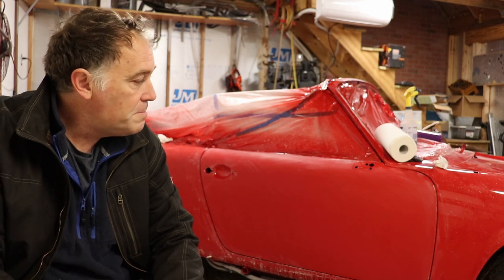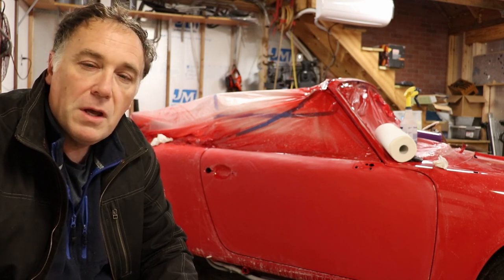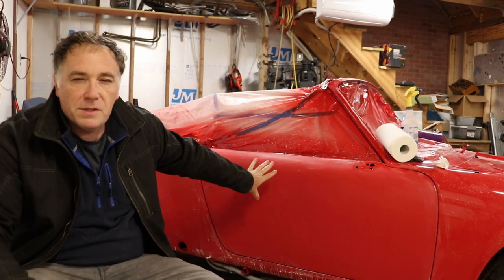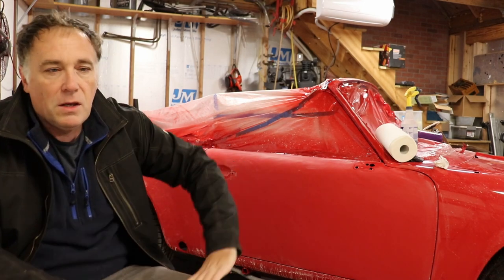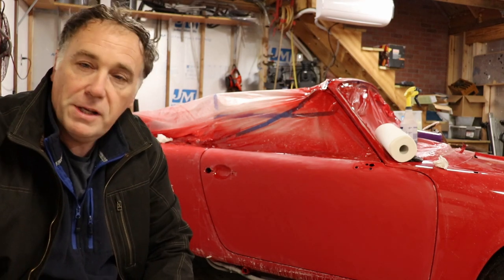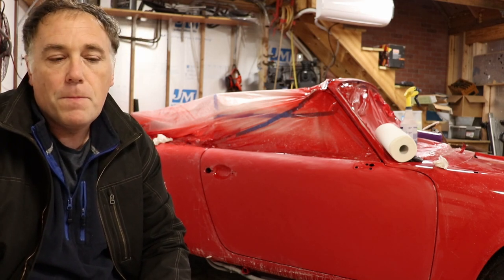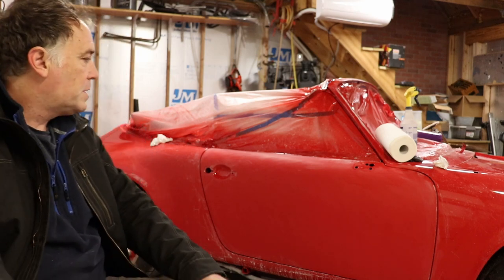With that out of the way, I'm going to show a few tips about when you're doing this. One is basically to get it sanded to a level of consistency prior to buffing it. And that is only something that experience will tell you. More or less, if it looks completely flat here, then it's going to look good when it's buffed. But that's not always the case. There's sometimes little things that don't even show when it's sanded flat, and that just is going to take a little experience.